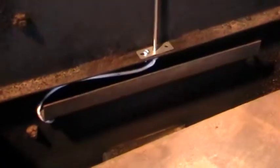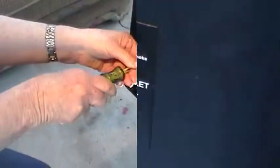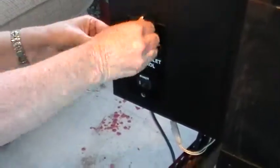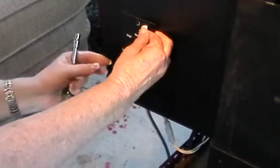What we've done is run the lead down the trough for the drip pan and then through the feed hole between the side of the barbecue and the hopper. Then we'll pull the panel out — the control panel — and replace it with the new digital panel. The next step is to unscrew the control panel, which has two screws. Before you get started on this process, make sure you unplug this thing from the wall. You want to cut all AC power off to it.